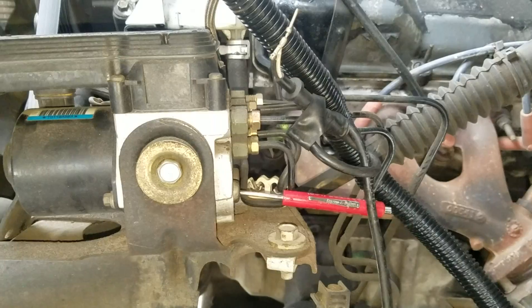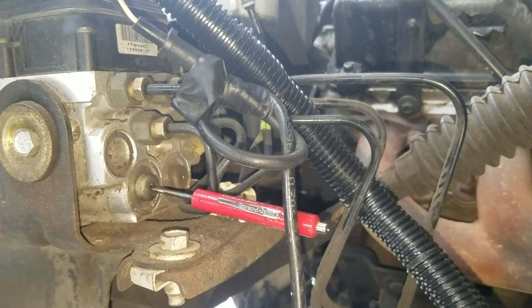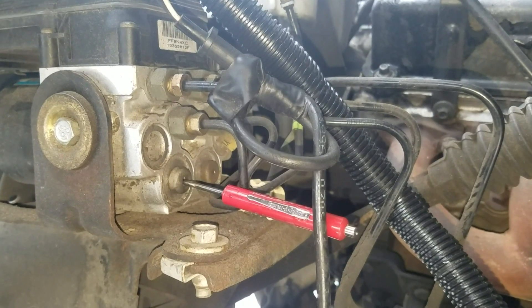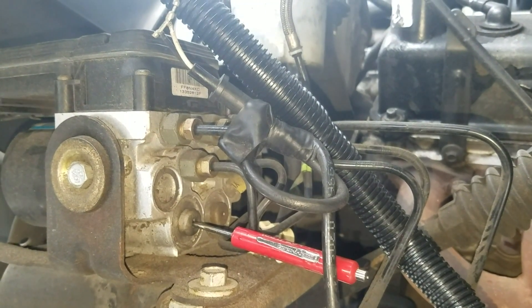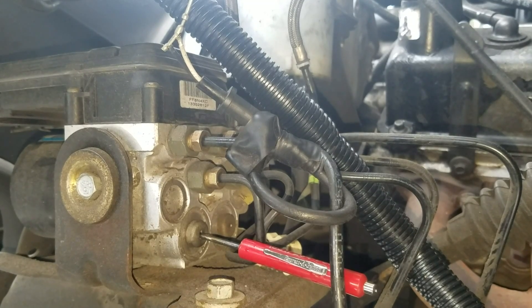The phone fell off, but as we can see that one moves a lot — we can see how much it moves, like three quarters of an inch. I want to show the two little rubber cups under there — we can see those. So we have a defective hydraulic unit here which is bypassing. Normally those valves should only open during ABS activation to release pressure from the wheels to prevent them from locking.